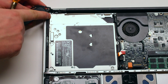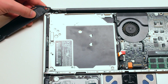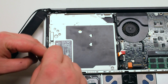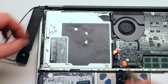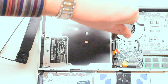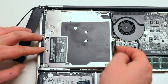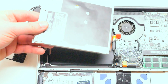The actual super drive is being held in with three Phillips head screws. Let's get those screws out of the way. Unplug the super drive ribbon cable that connects it to the logic board. Now that the super drive is free, you can tilt it and gently lift it out of its socket.